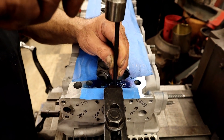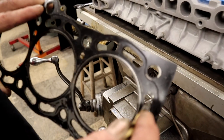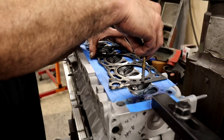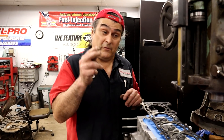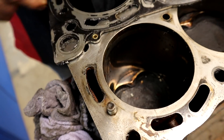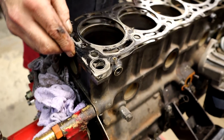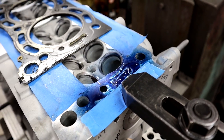We know we can put one there, probably one there too. We're going to find a drill bit that fits in the center. We don't need to be right on the money as long as we're smaller, but this size here seems to fit just perfect. We're matching the gasket — just using this to find the size of the drill bit. The gasket matches the block — not only is it the same size, but actually the block is a little bit wider. We can see that Toyota does have the provision for cooling in the back — they just decided not to cool the back. Maybe because there's an EGR cooler back there or something. So now we're going to put a hole there so that we can have some cooling.